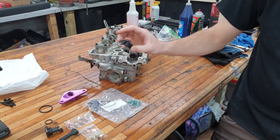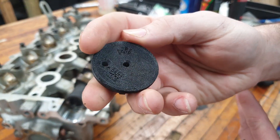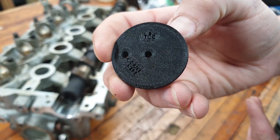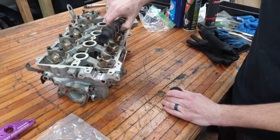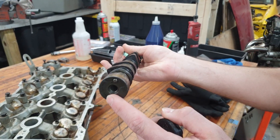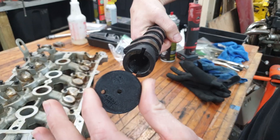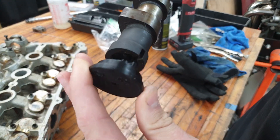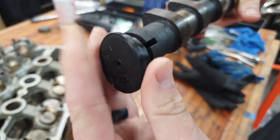This is where our little drill guide will come in handy. The drill guide has an arrow and text on top pointing upward for TDC, a hole on the left side that says 'drill here,' and a hole in the center. Check your cam - you should have an alignment pin on the belt side of the engine. When it's pointing straight up, that should be at TDC. Point the arrow up at TDC and it should slip right in there - and it does. You can't get this backwards; if you have it 180 degrees out, it will not slip back in the hole. So if it fits in, you have it correct.